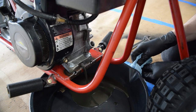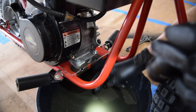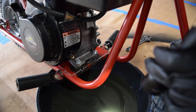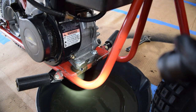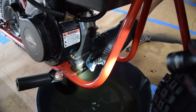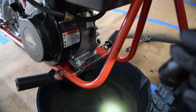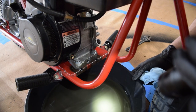The oil went in pretty clear and now it's coming out metallic and gray. Considering how bad it came out, this was fresh oil and it's only run for maybe three minutes. I'm going to put in at least one more sacrificial oil change to try to flush it out, even though I already cleaned it while having the engine apart. There's obviously stuff still floating around in there that needs to be removed. That is quite metallic.